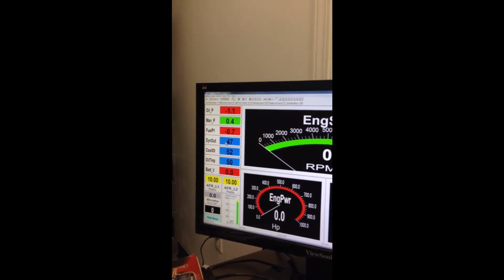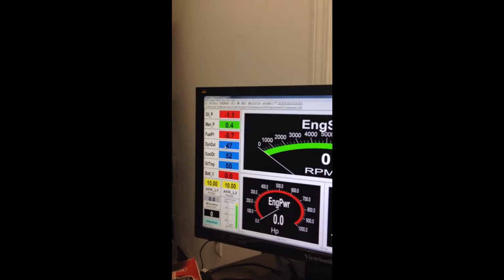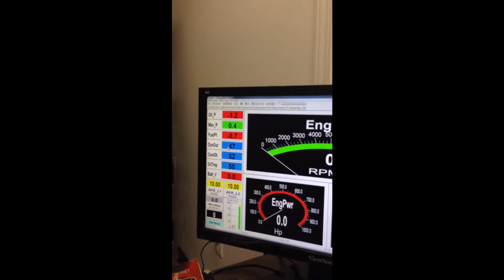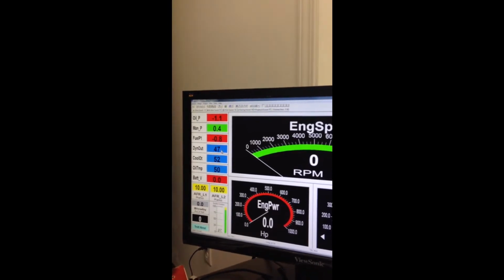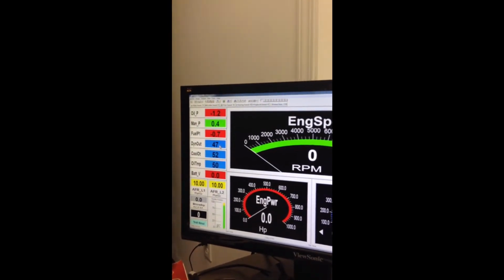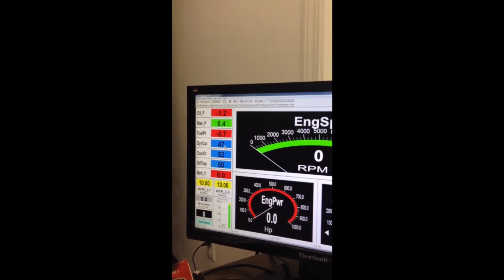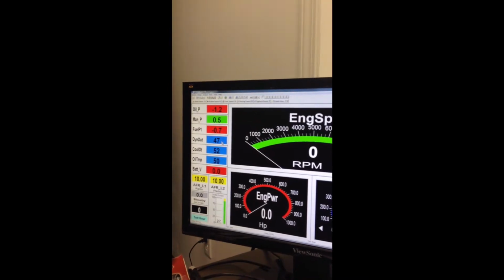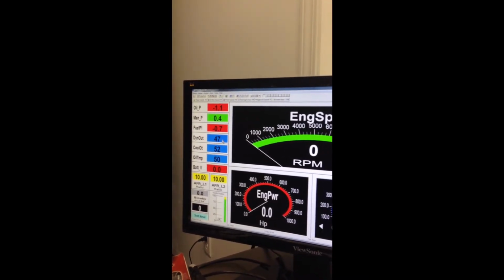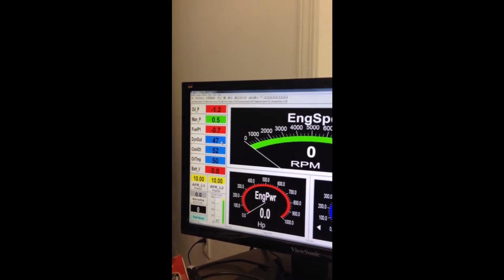This is the water coming out of the dyno. What a dyno does is it takes water and turns it into heat energy. And so the water going in is heated up, and that's what's converting the horsepower or the energy of the engine into heat. So right now it's 47 degrees. We haven't had this thing running, but if we were to start this engine and make a pull, this might go up to 150 degrees. One thing that you always want to make sure of is that you don't boil the water inside the water brake. So if this gets up to 180 degrees, you need to add more water, make some adjustments so that you don't boil the water in there.